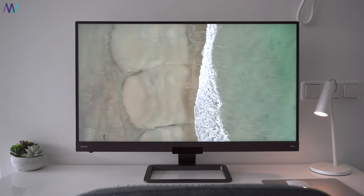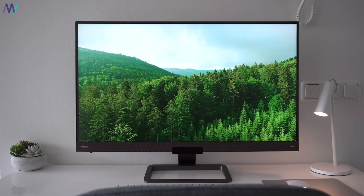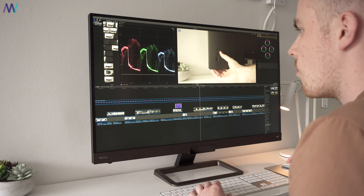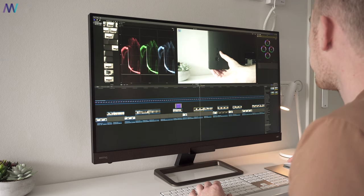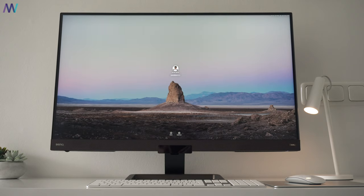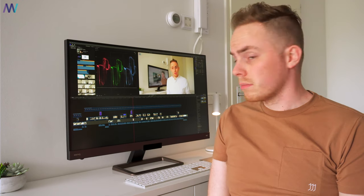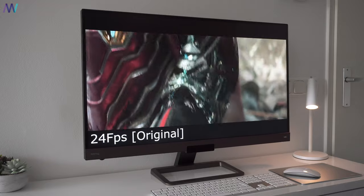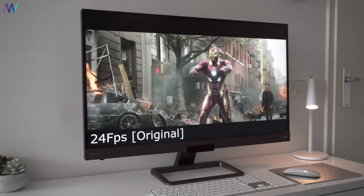Where it counts most, it's really good. The massive 32-inch display with a 95% DCI-P3 color gamut beats most other consumer-grade monitors when it comes down to video and photo editing. I have a colorimeter and can confirm that 95% is correct. It also scores 99% on sRGB and 85% for Adobe RGB. Therefore I am perfectly fine editing my future videos from this monitor. On top of that, there's support for 24 frames mode that provides a really cinematic experience for watching movies.